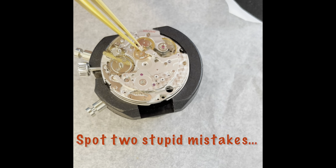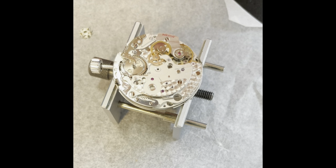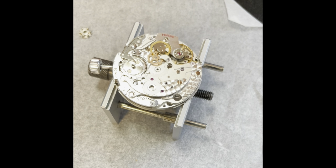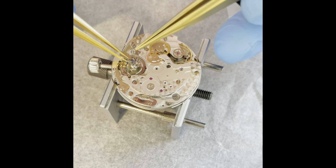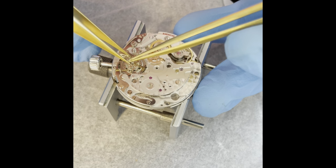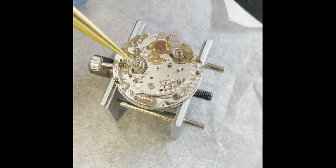Oscillating. Okie dokie, time for the column wheel. Grease up the pole which the column wheel goes on. Make sure we don't squeeze the little lever here. Nice. Now we've got the big fat screw that keeps it in place.